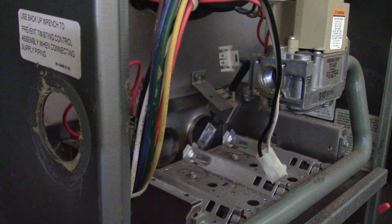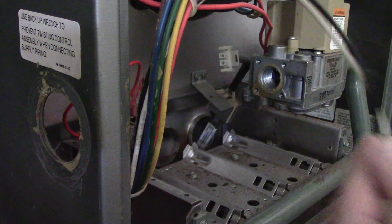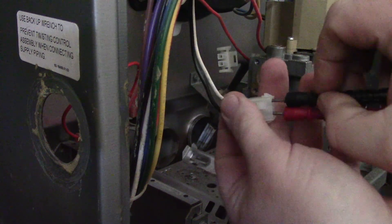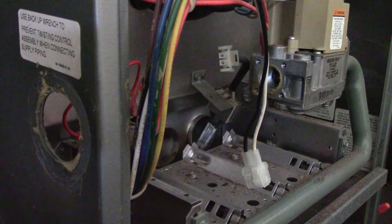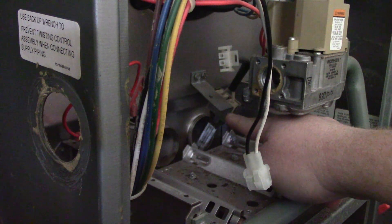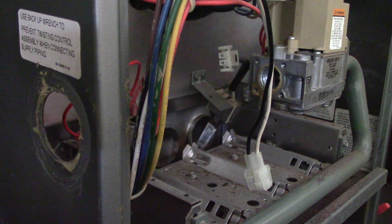On this side, when I was a service technician, I just got in the habit — even though it didn't glow — to put my meter on there and make sure you have 120 volts here. Nine times out of ten, when the igniter doesn't glow, this part is bad. But guess what happens on that other time — that 1 out of 10?